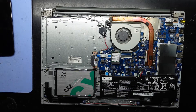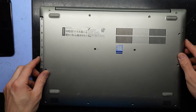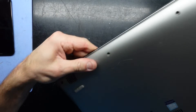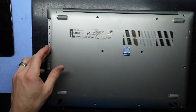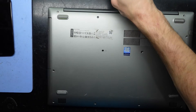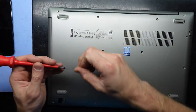So I just gave the computer a quick dust blowout, so now we're all good. Now from here, install the back cover once more — should rest on there and click into position. With that all clicked in, it should be a matter of sliding the disk drive back in once more, and then proceed to put those Phillips head screws all back in. With them all reinstalled, you should be right to continue with your upgraded machine from there.